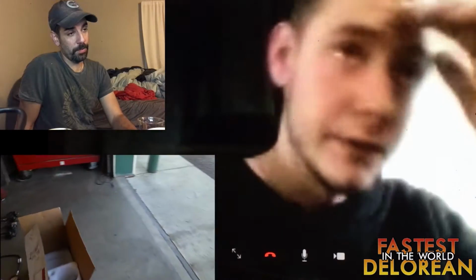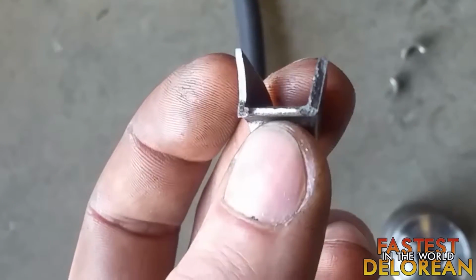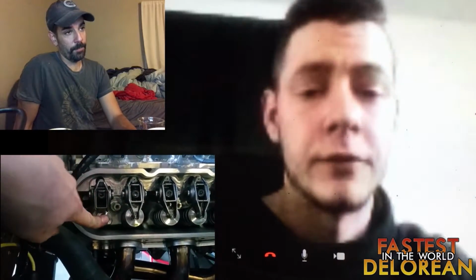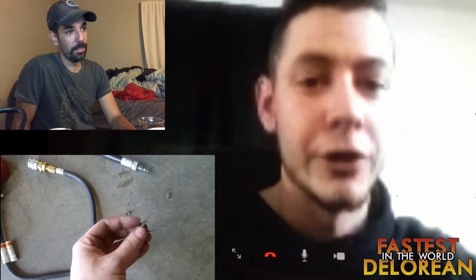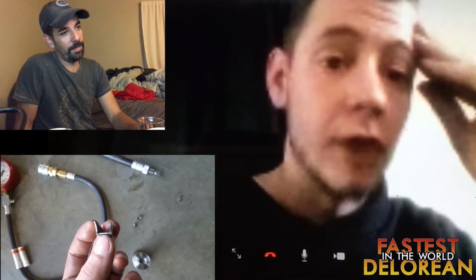So I showed in the video that I sent you how thin the material was. And if you could see it in person, it's very porous, too. It's supposed to be stamped steel, and it is clearly cast. Which is why it broke. They can't handle those valve springs. And you don't ever see that. You're not taking that apart when you put it together. You just get the piece and you put it in. Right. Yeah, I'm not going to cut off or break a new rocker and have to see what it's made of. Right. And I just didn't realize, if you see each rocker and each guide and each valve, that's just a piece that you put over top of the cams.